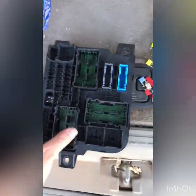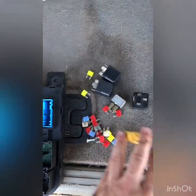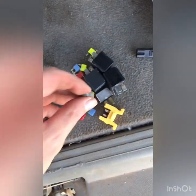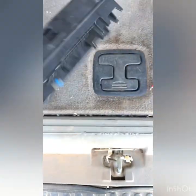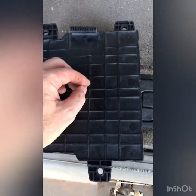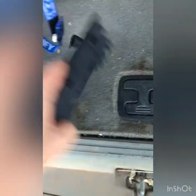Let's take this thing around back. What happened to mine was it kept getting water in it. I've stripped all the guts out. What I recommend doing before this is take a picture of it so you can just look at your picture and put the fuses right back where they go. There won't be any confusion, because you definitely don't want to put a two where a 25 was — it would probably blow whatever component it was. There's a screw located in the back here that holds the panel in. Make sure you take this out first because you'll forget about it.